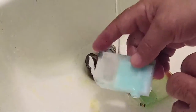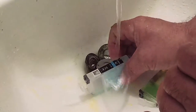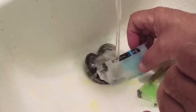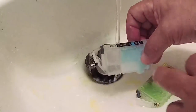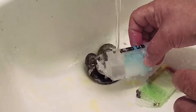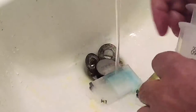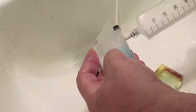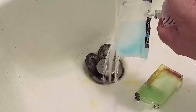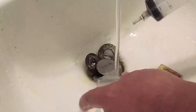For the cyan cartridge, we can continually flush it passively as before, or just begin to force water through it with the syringe — that will clear it right up. You can already see how quickly that clears the remaining stain. Load some warm water — do not use hot water, just warm water. See how quickly that clears off? We end up with practically a white sponge.